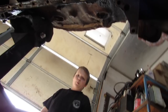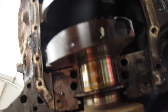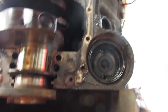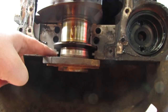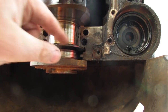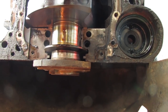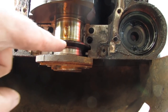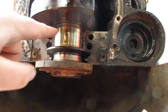I'm laying up under here, and I've rolled the top half of the rear main seal out — that was pretty easy. I just took a punch and tapped it gently without messing up the crank. And once it came out this side a little bit, I hooked it with a pair of pliers and pulled it out the rest of the way. Now I'm going to push the new one back up in there and begin assembly.